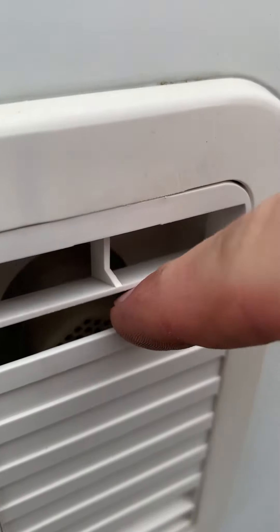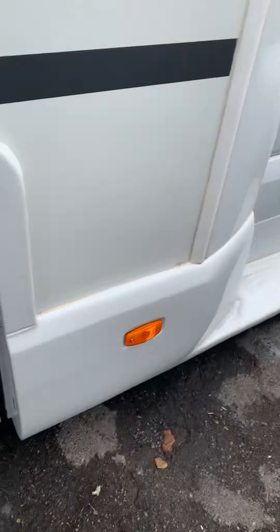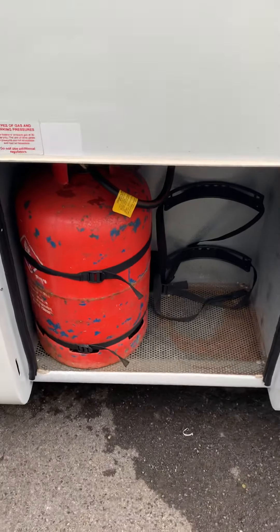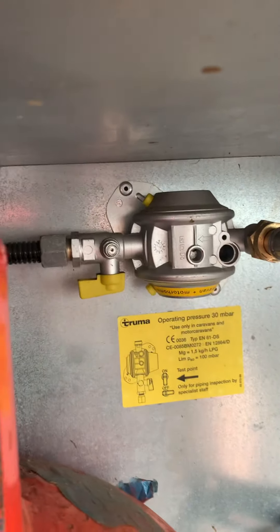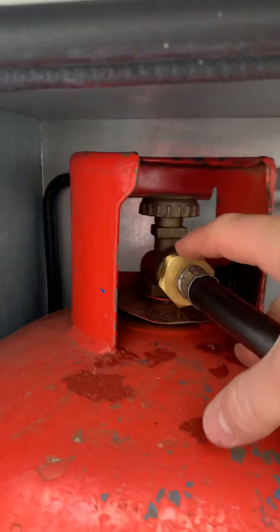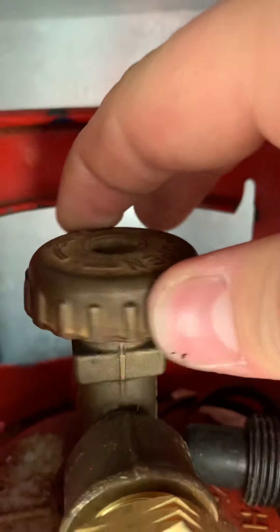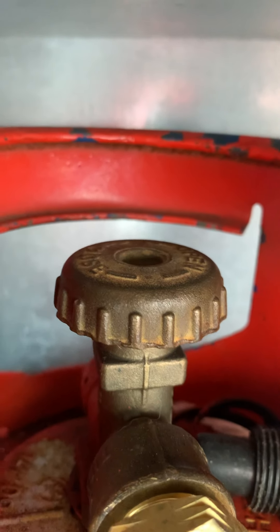Fridge vents here — I've got the fridge lit on gas at the moment, and you can feel hot air coming out through this top vent here because that's where the little exhaust is. I'll show you how that works in a minute. Your gas LPG locker — you've got space for two 13 kilo propane bottles, or whatever you've got. All you need to do is take this off when the bottle is empty and just pop it straight onto the other one and tighten it up. Turn the bottle on anti-clockwise to the left. When you come back to turning it off — before you start driving — you only need to go clockwise to the right for off.